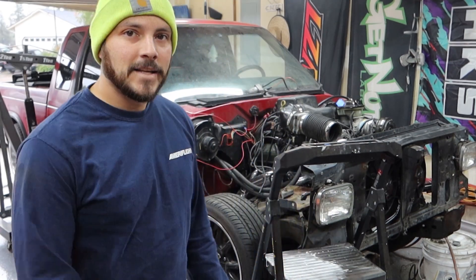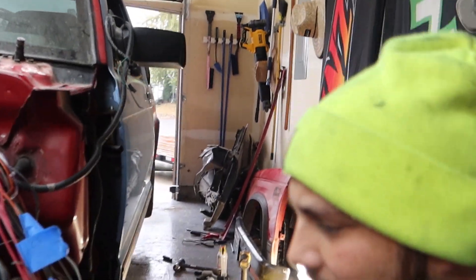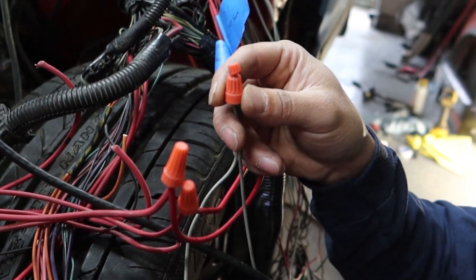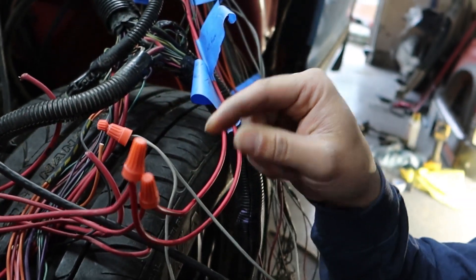Hell yeah! We're cooking off all the oil on the headers and stuff. But I noticed one thing - this wire cap melted. I don't know if I just had a bad connection causing resistance, but I'm going to try a new wire cap and get longer leads so when I put them in there it makes a good connection. I think I just did a loose, weak connection. It sounds like it's hunting, searching for idle, which is a little strange.